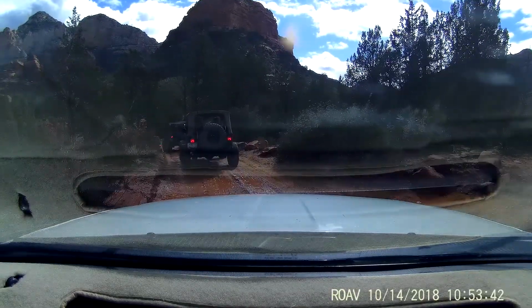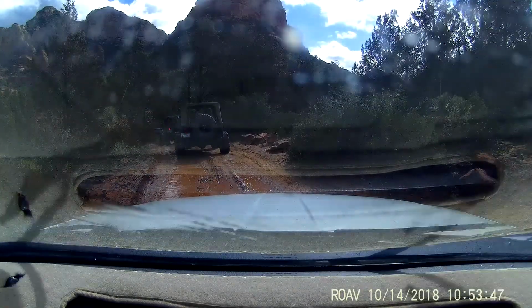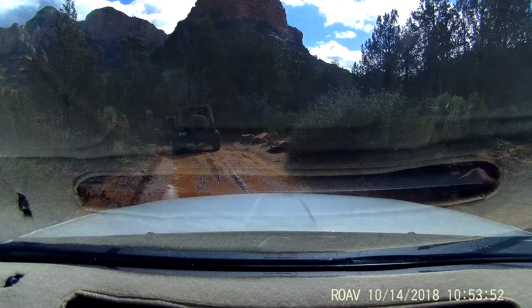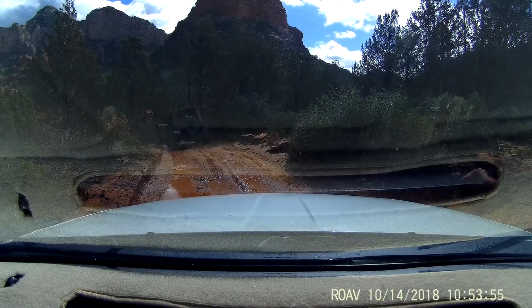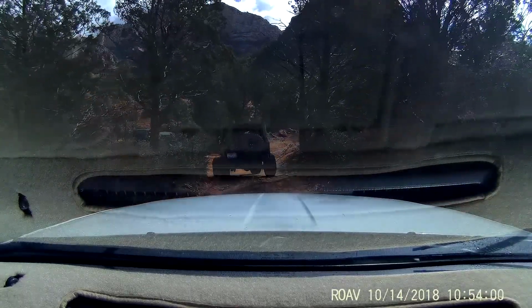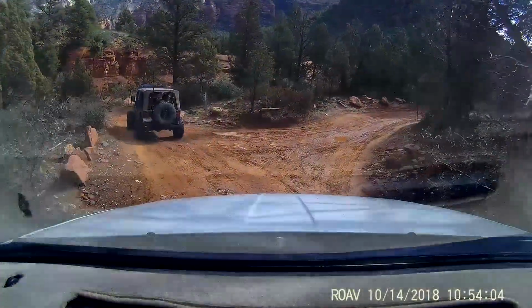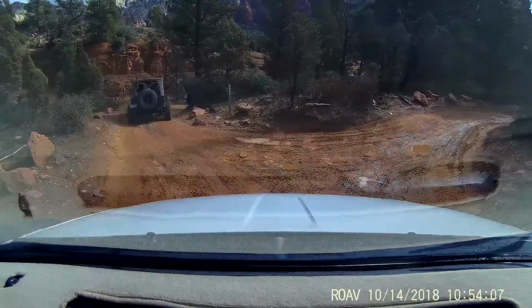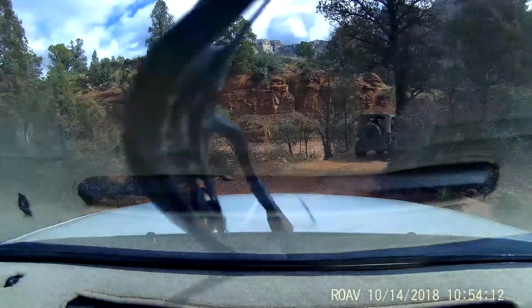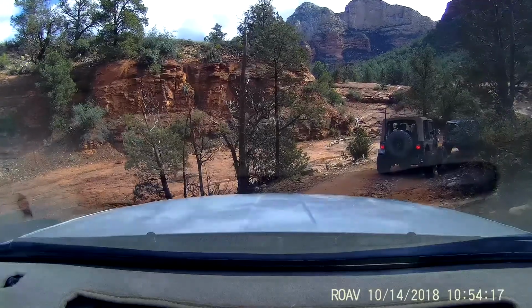And as you can see by this, it's not overly stiff at the same time, even though they were a pretty big pain in the butt to actually get installed because of how stiff they are just by hand. In order to install correctly, I actually had to completely flex the rear axle down to its lowest articulation point, at which point I actually had the disc brake on either side almost touching the ground in order to get these to actually sit in place correctly.